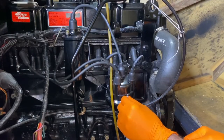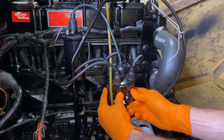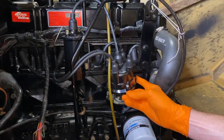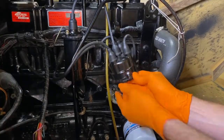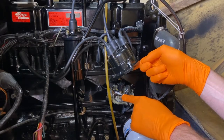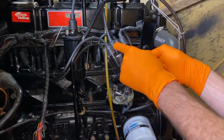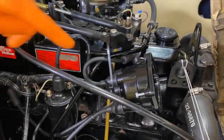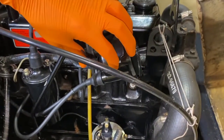Once you get both of these screws removed or loosened — you don't actually have to remove them, but you can — I recommend just leaving them in for organizational purposes. I can carefully pull up on the distributor cap, and you can still see all the spark plug wires are still connected. I might be able to position this up to a point where I can work on the points and inner mechanisms of the distributor. I may grab a zip tie and zip tie this cap upward, and I did just that. I have zip tied the distributor cap up and carefully removed a spark plug boot from the plug itself to give me better access.